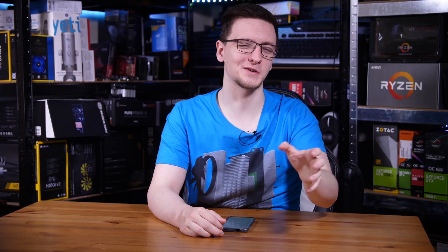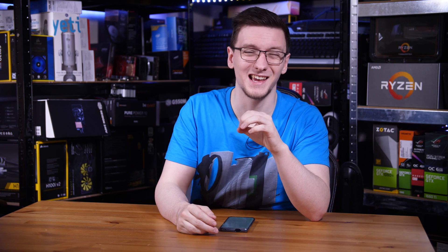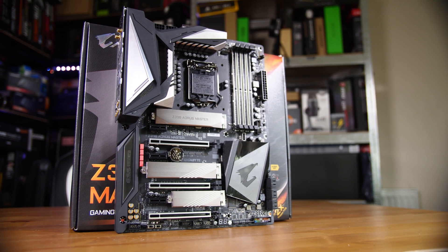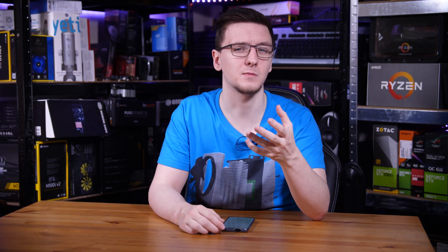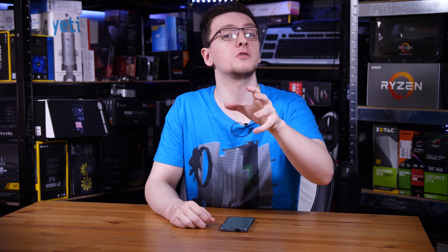For the less dangerous parts, starting with the motherboard: it seems to matter a bit more on the Intel side which chipset you go with, rather than AMD, which is a little more platform-agnostic. On the Intel side, you should generally stay away from the Z390 chipset, which unfortunately rules out the latest chips. Z370 seems to be a good option. On the HEDT side, it's generally better to stay away from X299, although most of those issues can be resolved with a few extra steps — so not the end of the world.